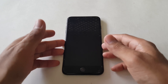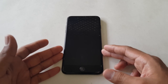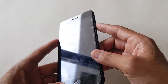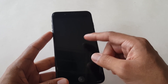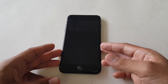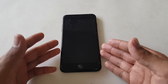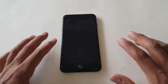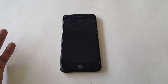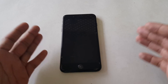This is assuming you waited five minutes and nothing happens — in my case I waited about 20-25 minutes and it was still going. As you can see it's not powering on. If you didn't do it right, the device is going to come on and you're going to redo it. Wait till it powers off, then power on again, powers off, then release the button. From here, let the phone just sort of restart and give it about 30 minutes. You can do an hour or two just to be sure.